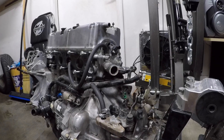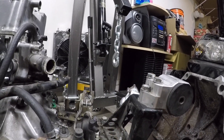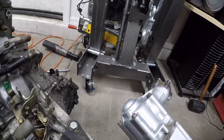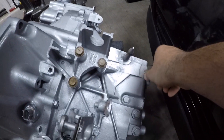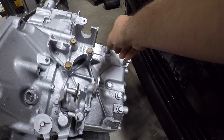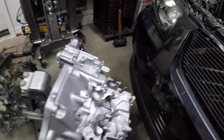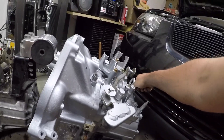On the mount, I removed the bolt so I could get the thread pitch, but that one was all janky — it's like they forced the bolt down on there. I pulled the bolt to make sure it threads into the all-wheel drive transmission, which it does. This one has two studs, so I had to go get a bolt for it. The nut was M12 by 1.25 thread pitch — I think that's what I ended up grabbing.